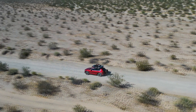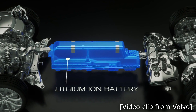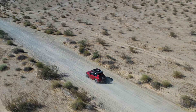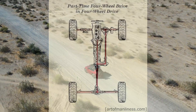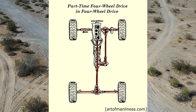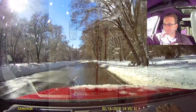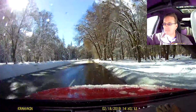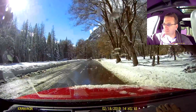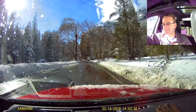It develops a kind of interesting situation though, in that there's no mechanical linkage between the front and the rear axle. It's an E all-wheel drive system. The downside of a traditional 4x4 system is the front and rear axles are locked together — they have to rotate together at the same RPM — and therefore you can't go around corners when there's raw pavement under your tires, especially in changing weather situations where it's snowy, gravelly, or whatever. You can't really use it until you're really sure that you're not going to cause damage to the transmission, the differentials, or even lose control.